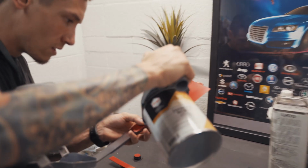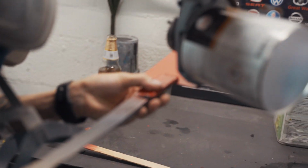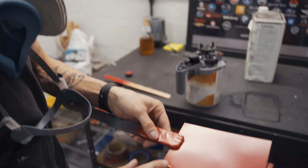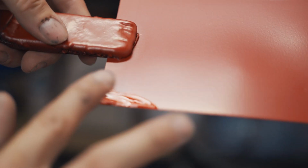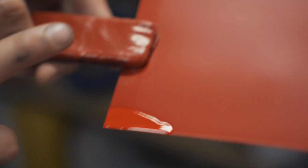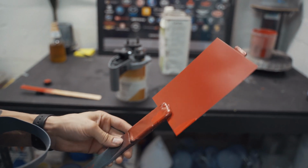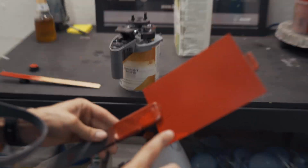Painting the S2000 right now. What'd you say you saw when you looked at the spray out card? It's like slightly too dark. Look at this compared. See how bright that red is? Obviously, the S2000 is not that bright red, but this is the factory color off the computer there, and it's too dark. So I'm gonna add some of this red, you can see, to try to lighten it up.